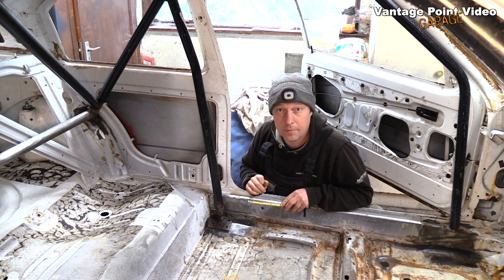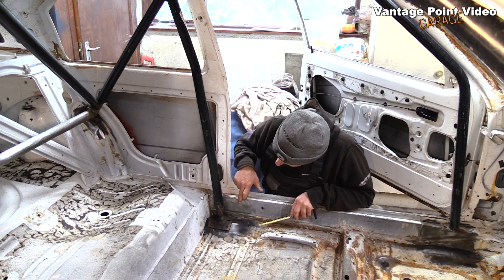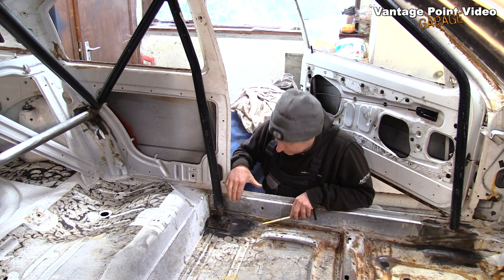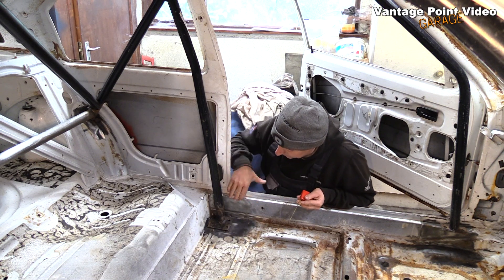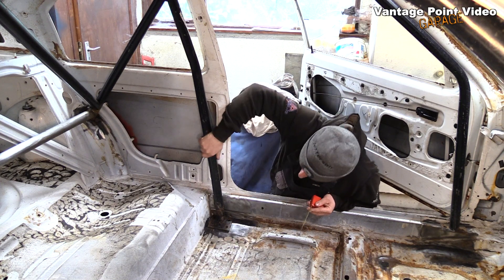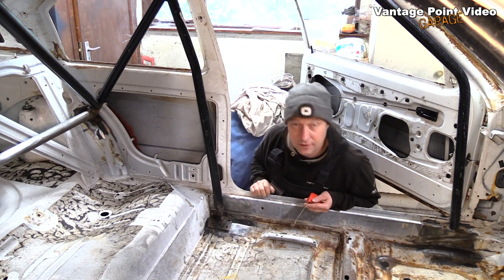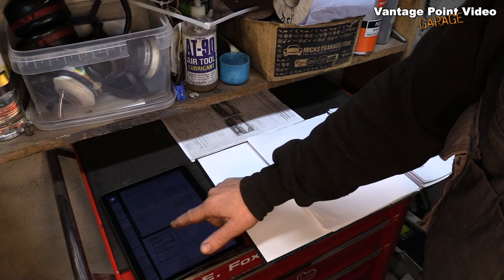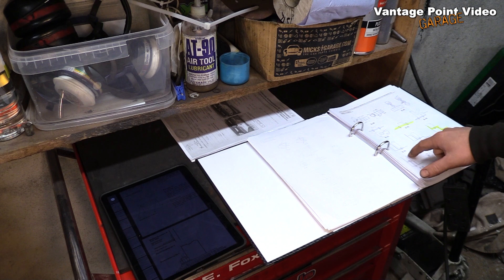There's one thing in Appendix J for 1980 which I liked, and that actually stipulated that you continue the plate up the vertical surface. So I'm going to put an additional piece welded to do the angle, to strengthen the plate along the vertical surface. That way, if there's an impact force coming down, it's not just stamping on the floor — it's also pulling against this. That recommendation for extending the plate up a vertical surface does actually correspond to a diagram in Appendix K as well.